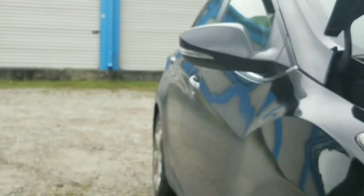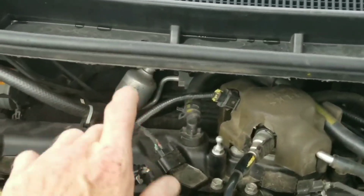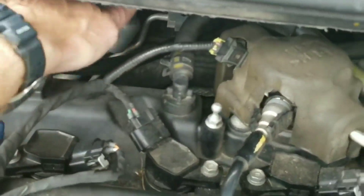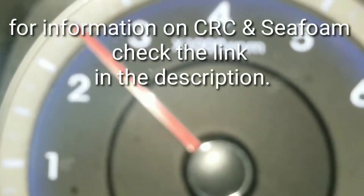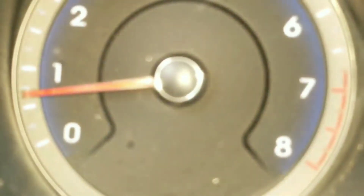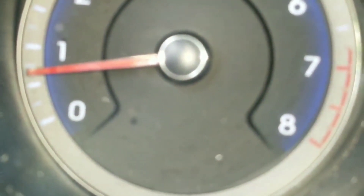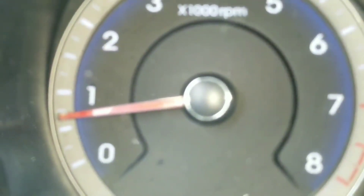We still can't see any smoke — guess not. Make sure you're safe every time that you do these tests. Please don't reach your hand back in here near the exhaust manifold. Accelerate to 3,500 RPMs two to three times once the can is empty. Once you've done this, go ahead and let it idle for just one moment, then go ahead and shut the engine off.